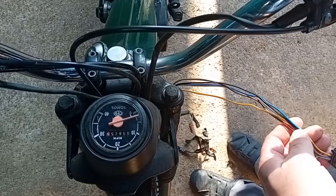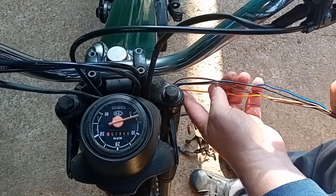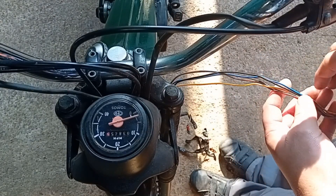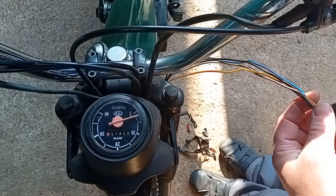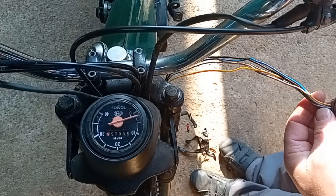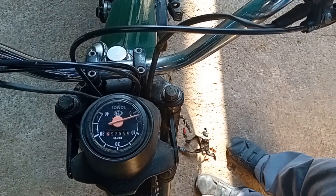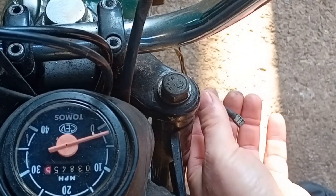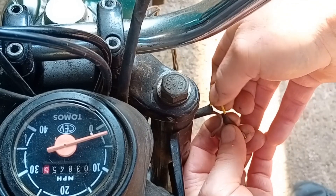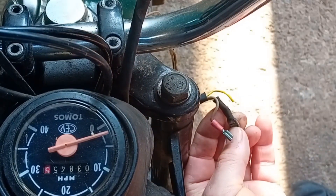No connection. So I've removed all the insulation tape off the wiring up to the switch to check for any breaks — it's fine. I knew there was a joint further down that I had to solder and put a piece of heat shrink on. When I fitted this aftermarket switch — because there's no multi-plug to take it off the loom on a Tomos moped, it's all hardwired and soldered directly to the switch — that joint was fine. The problem was actually on this spade connector: the feed up to the light switch had snapped, but it was hidden inside that piece of heat shrink so I couldn't see it.